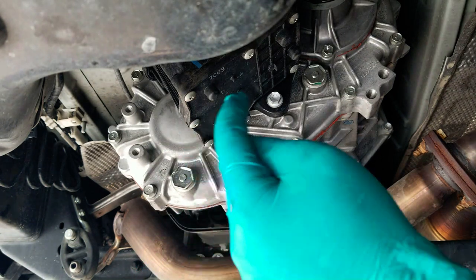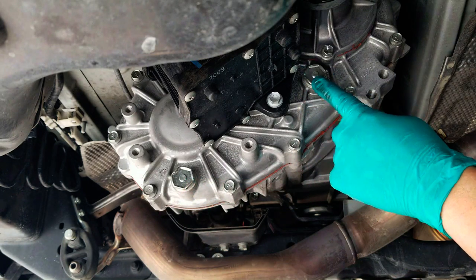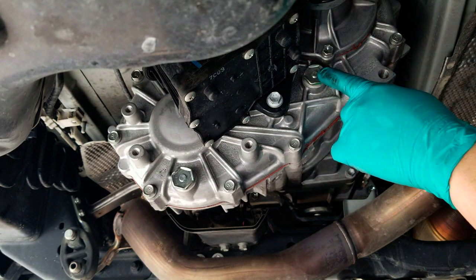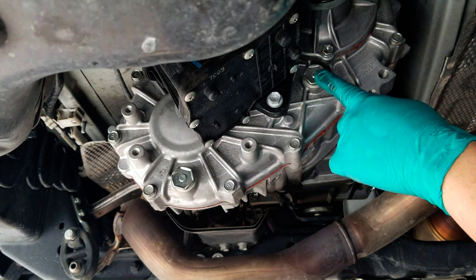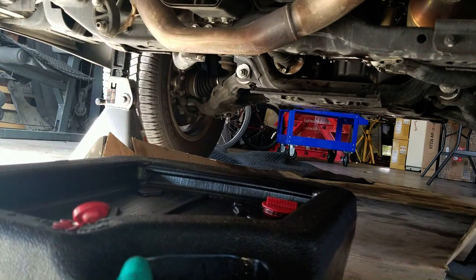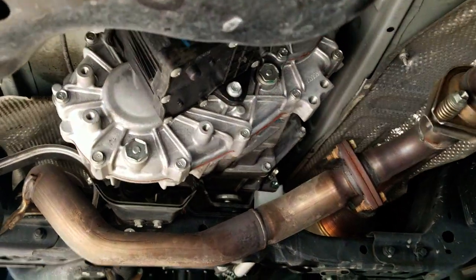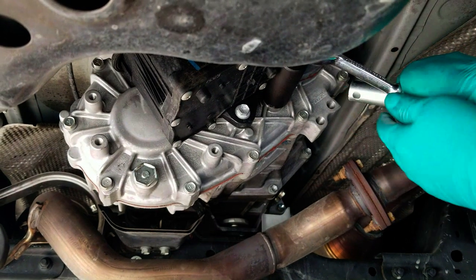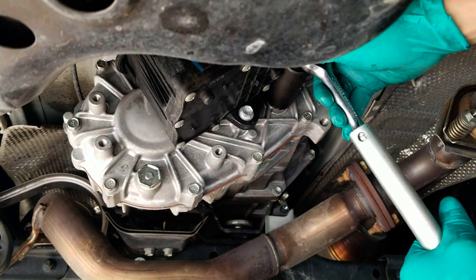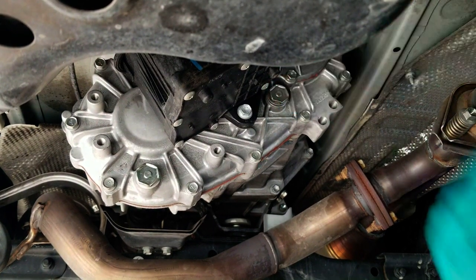Here's your transfer case — I've moved the camera closer, looking forward toward the driver's seat. This is your drain bolt, it's 24 millimeters, and luckily your fill bolt is exactly 24 millimeters also. You want to break the fill bolt open first, just in case it gets jammed and you're screwed — you haven't let all your fluids out yet. So break the fill bolt open first, then get your drain pan ready underneath your bolts.